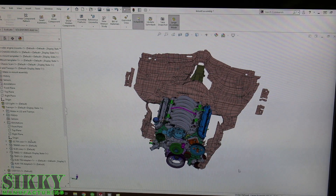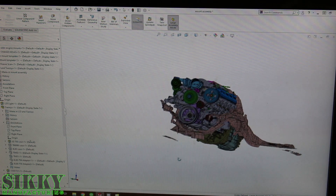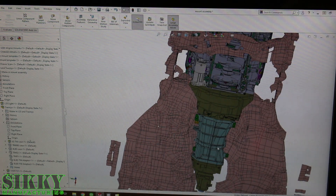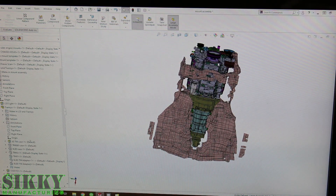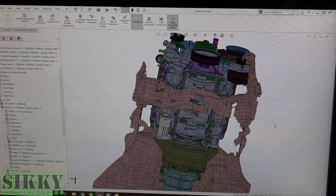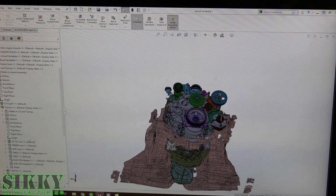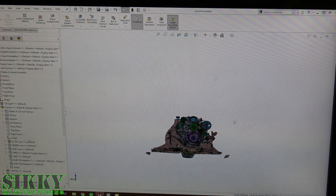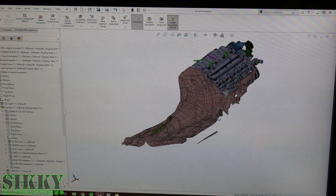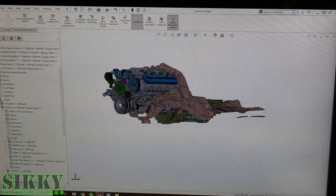Now you can see we've got the LS3 loaded in. We have all the different transmissions in CAD so we can go through and check fitment on all of them — this happens to be a T56. We've got it in here with the starter on it, you can see the bottom of the block. This will allow us to design and incorporate the oil pan and what sump style we're going to use. You can see how the front cross member comes right underneath the oil pan here, so a really low-profile oil pan like we make is going to be essential to get this in here with the motor as low as possible. The whole point in our mount kit design is to put the engine as far back as humanly possible and also as low as we can, just to keep that center of gravity down.